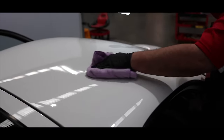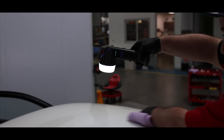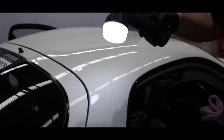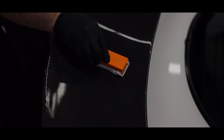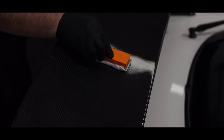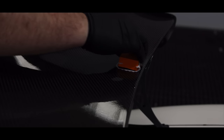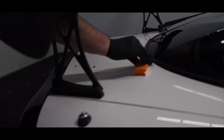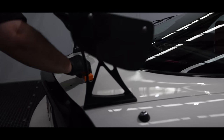But with Essence being an all-in-one primer polish, it also means that after a few hours, you can apply a ceramic coating over it, which is basically what the primer part in this polish means. So on a car like this that has so little clear coat, a fine primer polish will remove next to no clear coat, yet be able to restore much of the paint's finish with added filling and sealing capabilities. And then a ceramic coating on top will take it even further in filling in more of the defects and amplifying the gloss and saturation to another level.